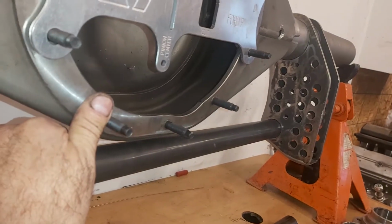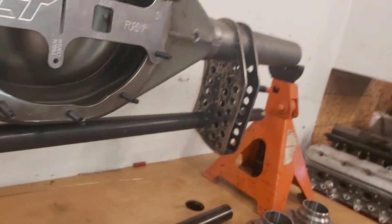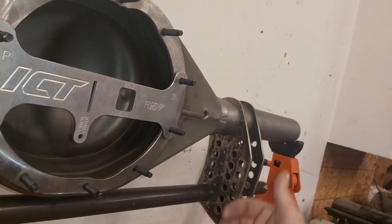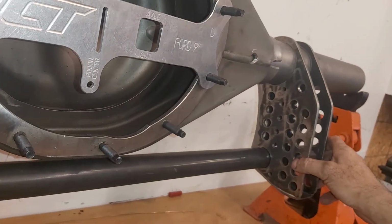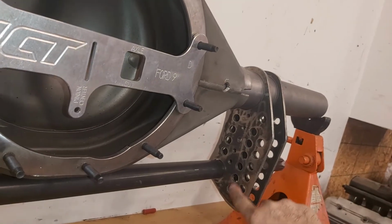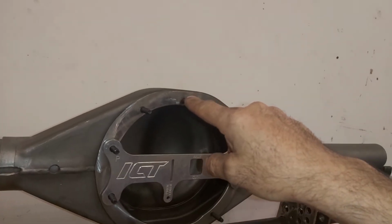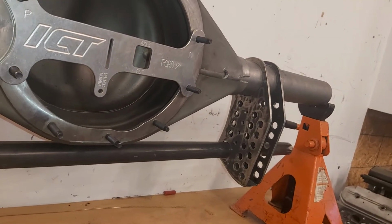So I was thinking about the old school 4-link equal length bar, where you had the holes ahead of the axle center line on top and bottom. This one, the holes are going to be on the center line at the top. And at the bottom, if I use these brackets, there'll be a smaller circle in the travel than the top. The top will have a bigger arc. And that'll actually, I think, lead to axle binding on its travel path.